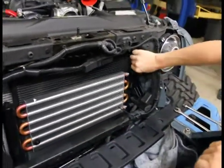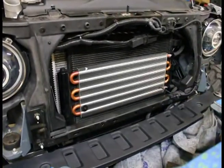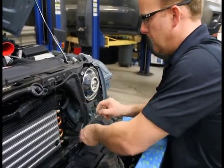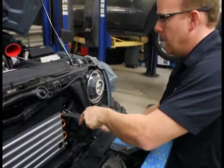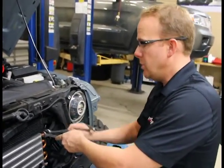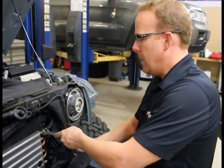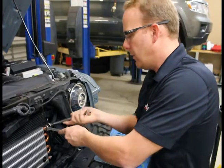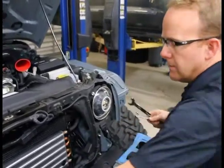It looks great going through there. Tighten these up, pull this through, and put the back zip ties — that's it for a transmission cooler. Very simple. Got my zip ties through, the hose is routed, I'm just going to tighten these here. The two zip ties go on the very bottom — not at the top — because it'll be very tight up there. Use two zip ties on the very bottom so you don't reduce clearance, since it's very tight in the front grille to fit this oversized intercooler.